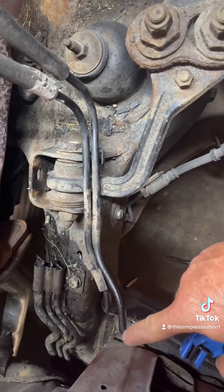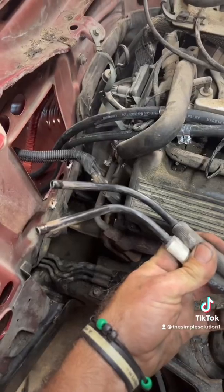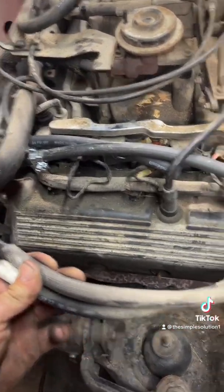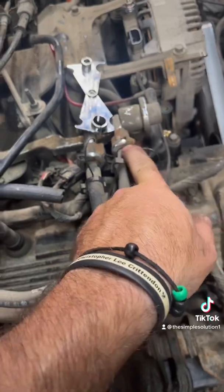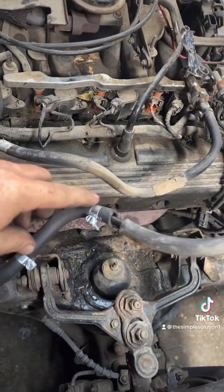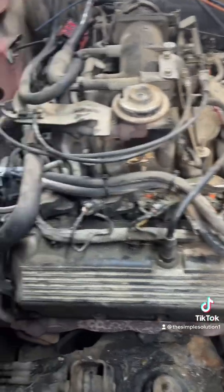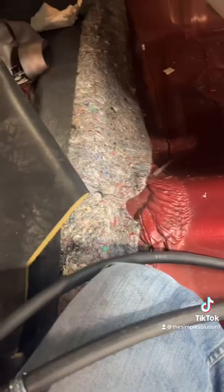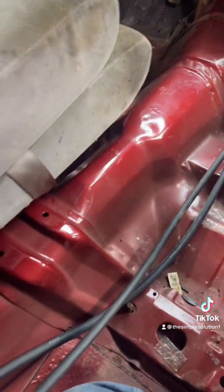Where I cut them with side cutters, I usually cut right here with the tubing cutter and clean these up. Once cleaned up, you're ready to put your hose on — I use 3/8 hose and double clamp both lines. Keep in mind the line with the regulator on it is your return. I double clamp my lines and shove it up past the curve and clamp past the curve. The final product under the hood: everything's tucked, hose clamps aren't hitting, zip tied to the fuel rail. Eight foot of line is what I use per side.